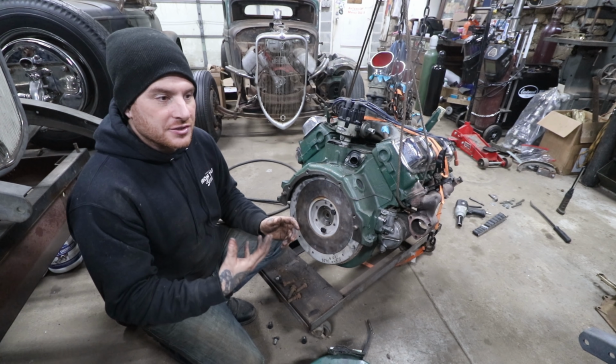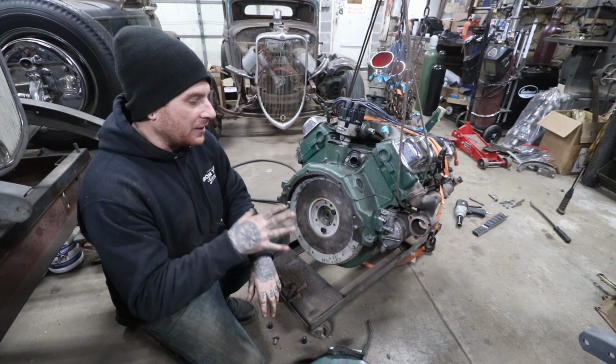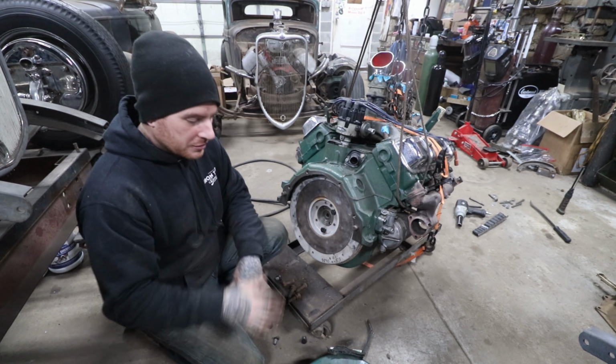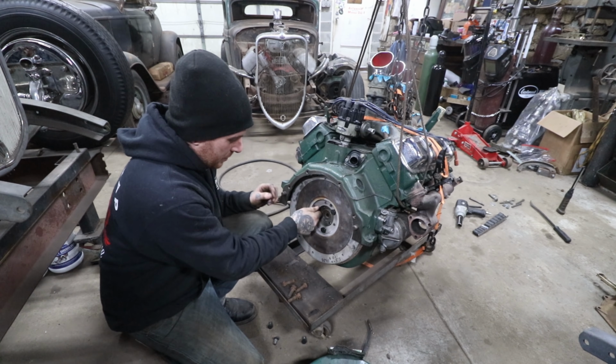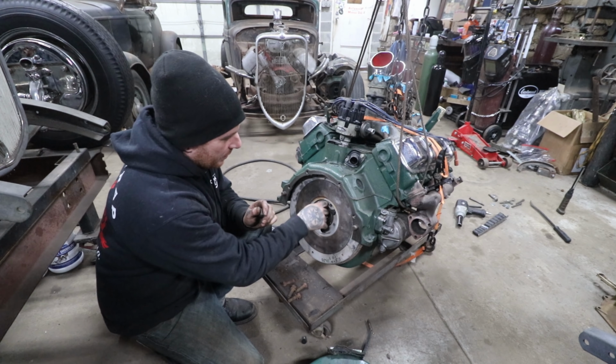If you're in some of these Fords, depending on the car, you may need to swap the starter over. So there's starter changeovers for these, super easy to swap over. This car had the engine in it without a starter changeover, so I'm hoping it's okay. So we will see with that. So I'm gonna get these all bolted up, and then we can keep moving along here and try and get this transmission bolted up so we can slide this sucker in there.